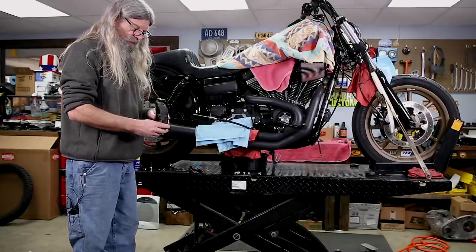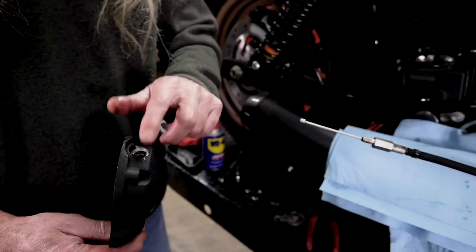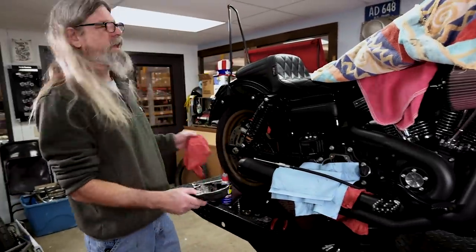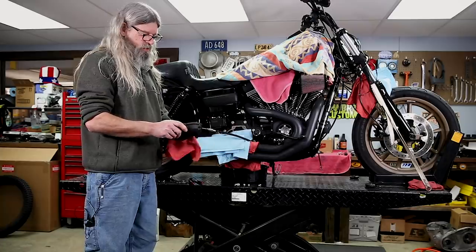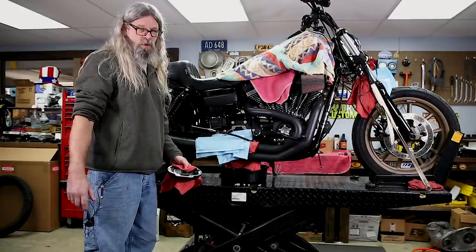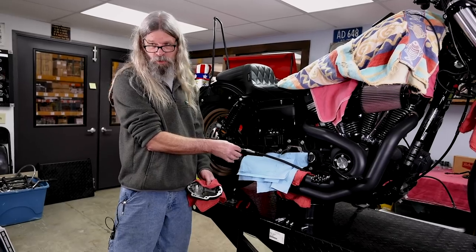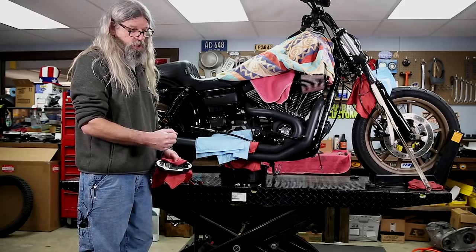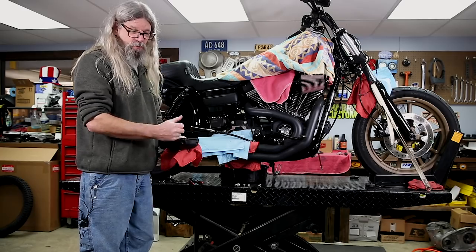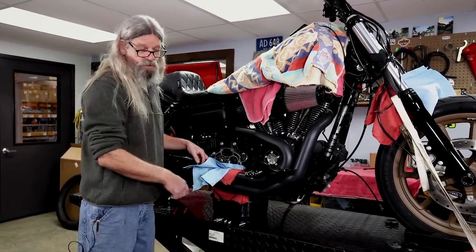There she is — she's off. Look, there's an O-ring. Be careful that you have your O-ring or this will leak. Also worth mentioning: I've been having a lot of customers lately changing clutch cables — most often on a Sportster — calling or emailing saying the new clutch cable just broke when I was installing it. The reason that happens is because this has threads but it's hollow for the cable, so you don't need to crank it down like you're trying to torque something. You just need to tighten it down so that it seals — that's why they're breaking, because they're being over-tightened.